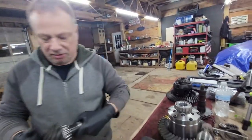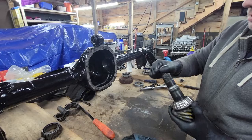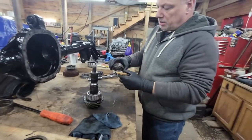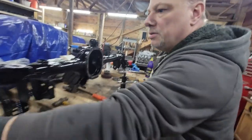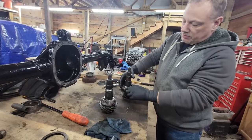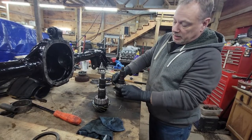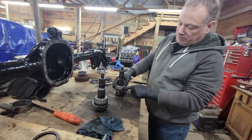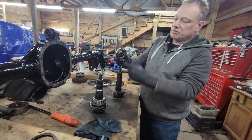Let's show you how to do that. First thing we're going to do is put the pinion in. What we did was we used the old gear — this gear here we filed out. So it slides right over all the way down, and that slides over that because this gets pressed in. This way you use your old one; these are the same manufacturer. You can buy another one — they're fairly cheap — or you can grind out your old one like we did, because this one here is actually in really good shape.